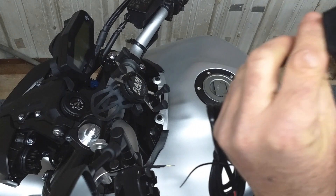This is the plug that went to the inside — this is what we're going to use to plug into this accessory socket. We're going to remove the two rubber plugs in here. Now this is open. Just put these pins back in to hold it in place so that I can see how much wire I need to cut. This is the one off of the USB port — just a couple of inches past the edge of the tank. So we can strip this back. Once we've peeled back the insulation on the USB port, we have a red wire and a black wire. The next thing we have to do is figure out what is positive and which is negative — there is a black wire and a brown and yellow wire.